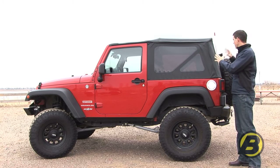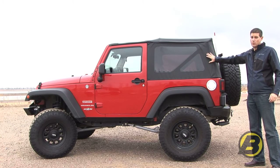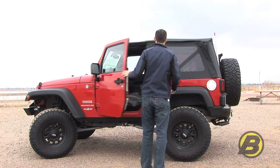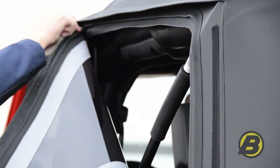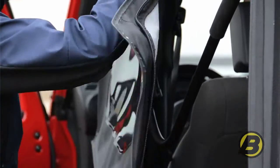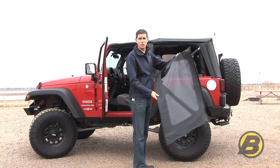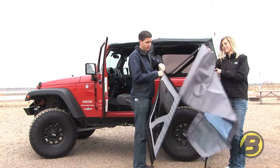There's no hard and fast sequence we have to follow in terms of window removal. I'm going to remove the quarter windows first, but you can do whatever works best for you. We start by releasing the Velcro on the back and on the top. We also need to open the door to ensure we've got clearance for the retainer. Undo the zipper, releasing the retainer at the bottom and also the retainer from the door rail. Finally take it out from the zipper slider. When you remove the windows you need to put them somewhere safe — you don't want them blown out the back of the Jeep. One solution is the Bestop window storage duffel, which Britt has here.